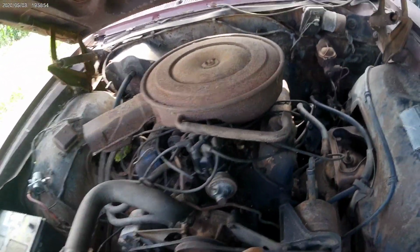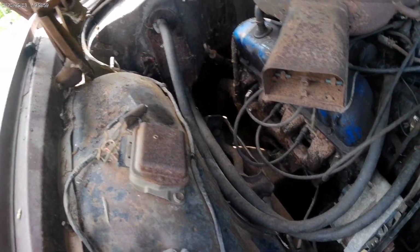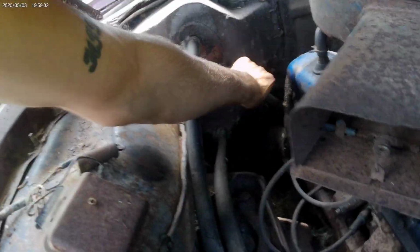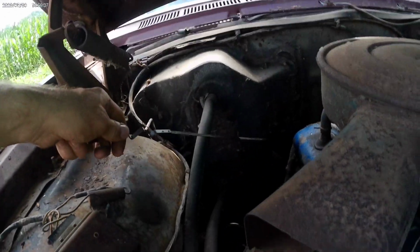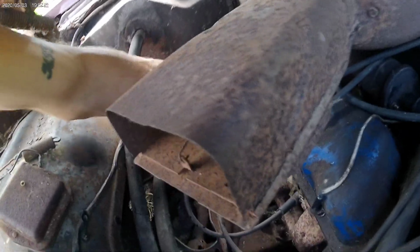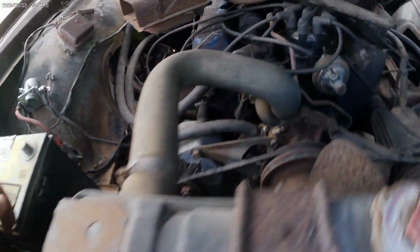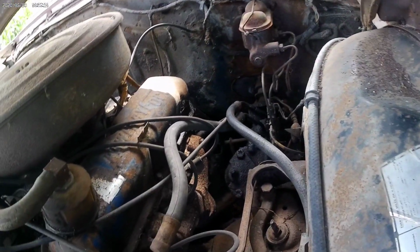Got fuel pump, almost guarantee needs replaced. Got one of those. Not gonna worry about brakes right away because the pedal's rock solid. Check fluid. See where this is at. Oh, it's got probably enough to drive, depending on how it goes down once it starts. Okay. Got that. I do remember I got out a bunch of bushings and things because stuff was wallered out. Either one of these control arms was something was bent or missing. Not quite sure.